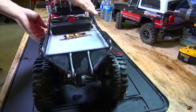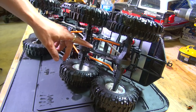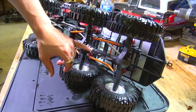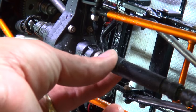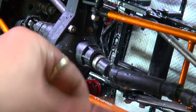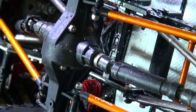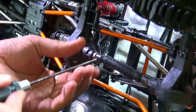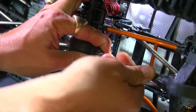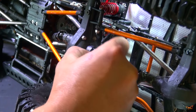All right, clean desk — everything looks good. I already have an idea of what's going on in here and I'm pretty sure that I've broken the pinion shaft. That's basically the shaft that comes out and attaches to the drive shaft right in here. This whole piece is just sliding out. The only way to tell for sure is to undo the set screw that goes straight through the output drive so I can remove this drive shaft. This set screw actually goes all the way through. I'm going to try to back off this drive shaft here. That's a pretty good indicator something's broken on the inside. Here's the bearing.